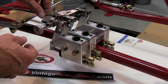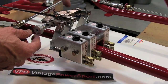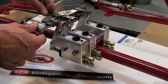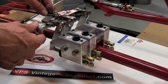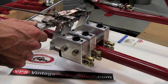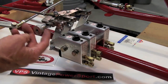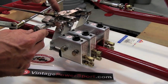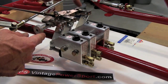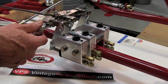You can see the brake rod comes in here, and there's a slot that's been calculated for position to get the right balance. That calculation is based on the caliper piston area and how many calipers each master cylinder is actually feeding — that's how I figured out where the position of this went. There's a knob here that turns and will move this back and forth. This is all made out of 303 stainless steel; all the clevises are custom made, all the pieces were made for it.